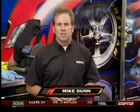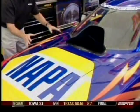The concept of a burst panel can actually be traced back into the 1960s. The top fuel and Funny Car teams designed it to help relieve pressure and help save engine parts. In the case of the Funny Car, this has evolved over the last few years — they take the same basic principle to help save the Funny Car bodies.